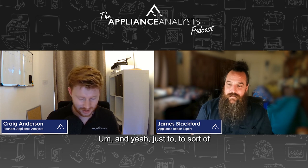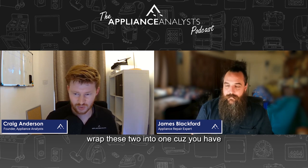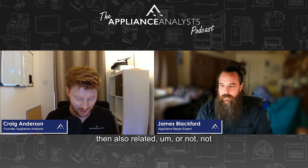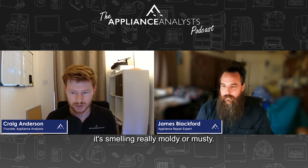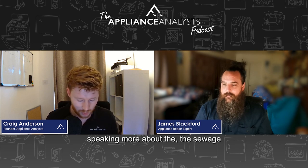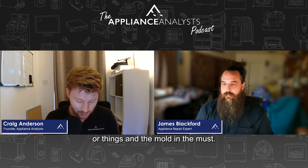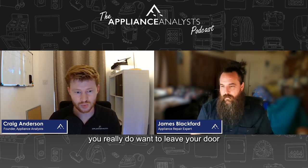Oh yeah. And just to explain there, I think we can maybe wrap these two into one, because you have when a dishwasher is smelling more like sewage or off food, and then also, not related, but can smell similar, if it's smelling really moldy or musty. Yeah, I think we were speaking more about the sewage smell, mostly with the garbage disposal or the filter going bad, and the mold and musty smells are a buildup where you really do want to leave your door open.